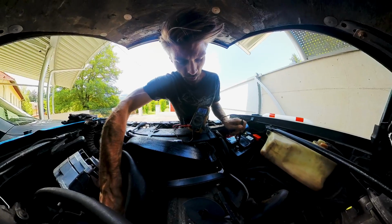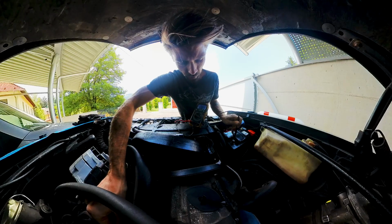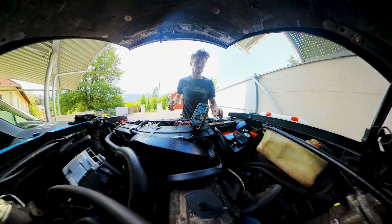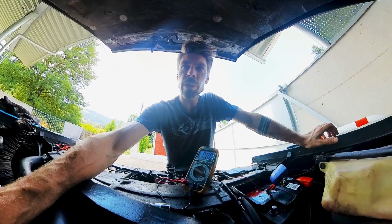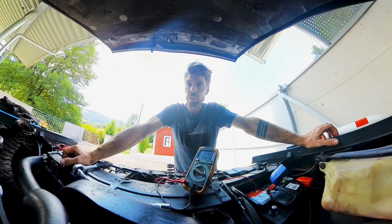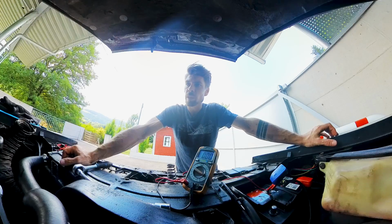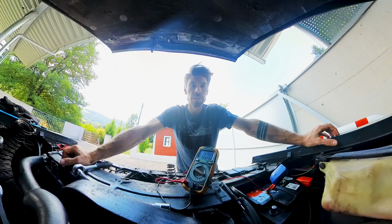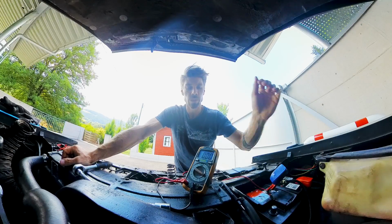0.89. If I switch off the oil pressure, nothing changes. Water temperature, still no change here. This is weird, because I thought that maybe the oil pressure switch grounds out, because all the other wires looked okay in the wiring loom. No wire did ground out there. So every wire in those wiring looms looked okay. It was just this one connection the previous owner butchered together again. But other than that, I couldn't find any visible culprits. I measured all the wires, nothing grounds out there.